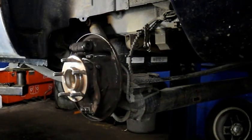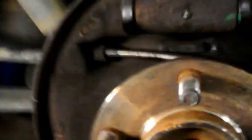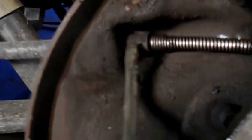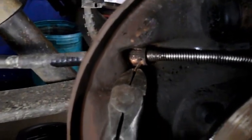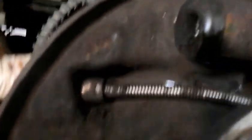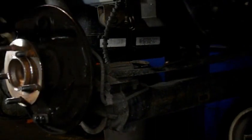This is the cable from the vehicle that we're going to replace with a new one. They have these little clips right here that hold it in place. Since we're not going to be reusing this cable, what I always do is just get underneath it with a screwdriver and twist it out. We'll break all three clips off, then rotate the cable around - there are three of them on there.